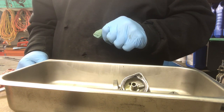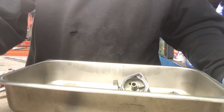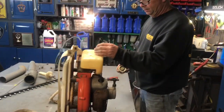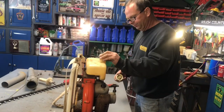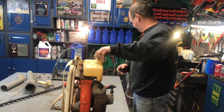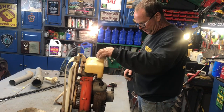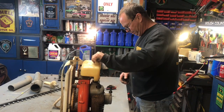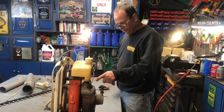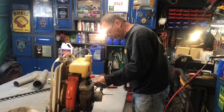We'll get it back together the same way we took it apart and get it back on the machine. So I cleaned the carburetor, but I don't have very high hopes for it, because I dropped the high-speed jet and I can't find it anywhere. Looked all over. So I kind of made a high-speed jet. I don't know if it's going to work, but we're going to try it. I've got gas in it. We've got a little leak by the petcock here — let me just put a paper towel in there and let's see if we can get it to do anything.